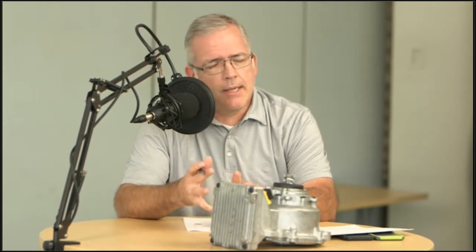Sure, the FAS being connected to the yaw rate sensor and the other sensors that we mentioned, the external signals, it has as much input into rollover situations, steering, braking, etc. It's not going to steer the truck for the driver because this is an overlay system, but it's going to add inputs through the ABS controller, which will help with stability, braking functions, of course, and acceleration functions. So it'll help in that way, but it's not going to directly steer a truck out of a rollover situation.